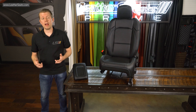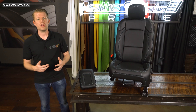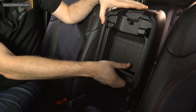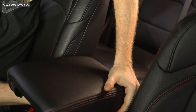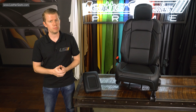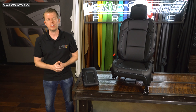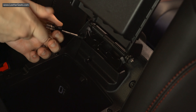We're currently selling this wireless console upgrade for the JL Wrangler and JT Gladiator as an installed item only. Your console lid is easily removed with only four T20 Torx head screws. Once removed, we send you a call tag to ship the lid to us for the upgrade. Your new wireless charging console lid will arrive ready for you to bolt back in. There's no custom wiring required if you power the unit using the factory USB outlet inside the center console lid storage space.